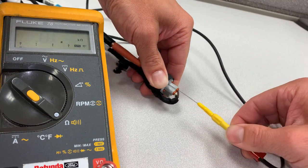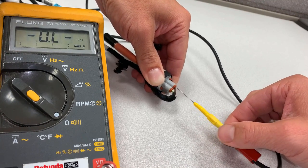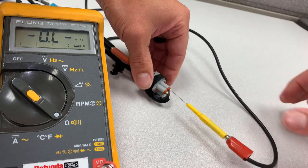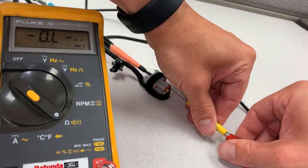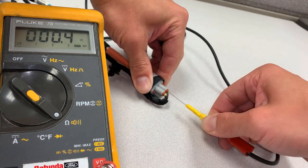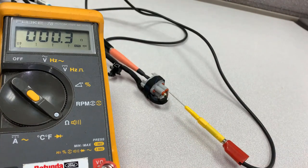As you can see, you may have to adjust your back probe to make good contact, especially on weathertight connectors. When you confirm there is continuity between the pin and back probe, remove your flex probe, carefully reconnect the connector, and proceed with the test.